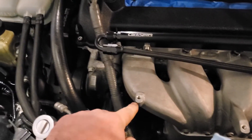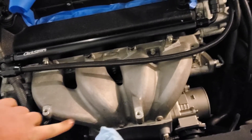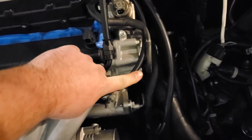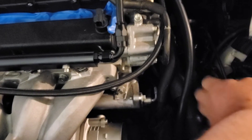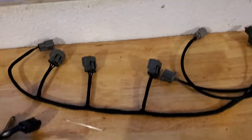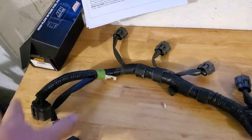It's a little confusing, but that big gray plug would normally pop up here. You tuck it under your manifold and there's an extension harness that runs underneath so you don't see it — it comes up and plugs into where it would normally plug into on the wiring harness. So that way you don't have the ugly wiring over here on the left side of the engine anymore.